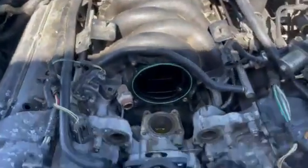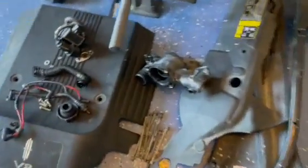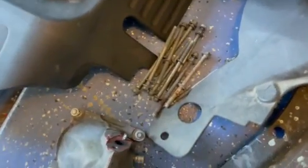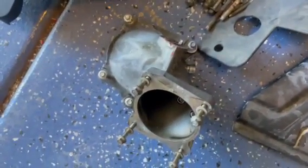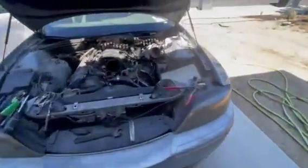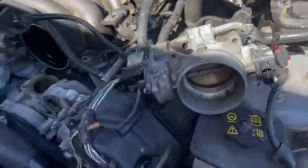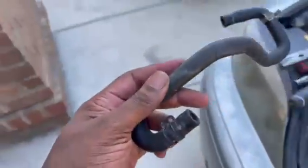The intake had to come back a little bit. I had to take the windshield wipers off, the thermostat, the bolts of the intake, the throttle body — all this stuff came off for this little bitty hose. There's the throttle body right there. All this had to come off just for this little hose.